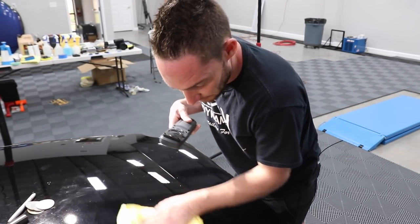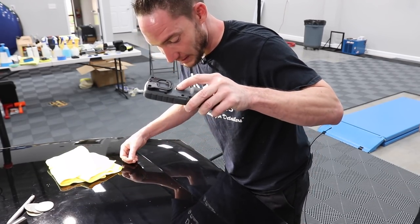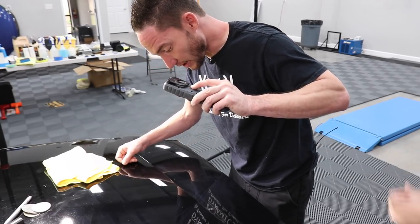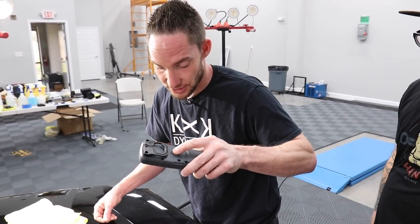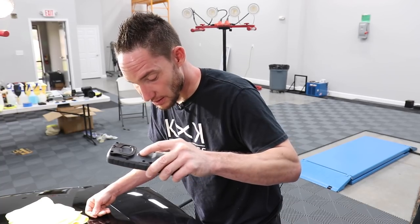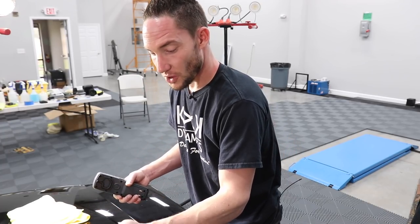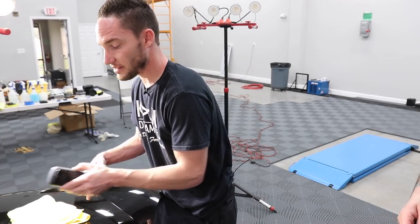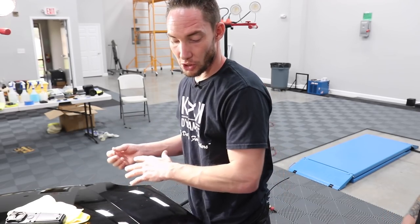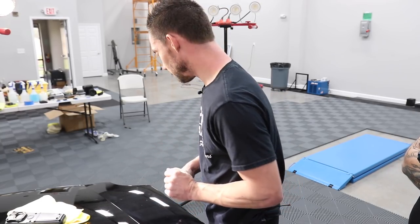It's paint dependent. I've been on cars and projects and panels where anything I throw at it, after all my 18 years of doing this at a higher level, I'm just as bad as the newbie. Sometimes it's a real pain. That's when the skills really come into play, focusing on the fact that everything you do has consequences. I see a lot of detailers change four or five things at once. They're always quick to change a compound or a polish or a pad when, what if we just let it cool down, blow out the pad, and put it back on the paint?